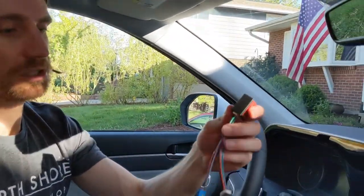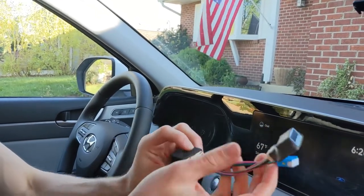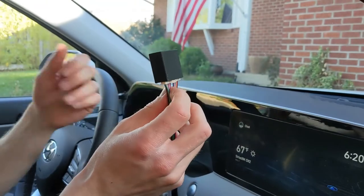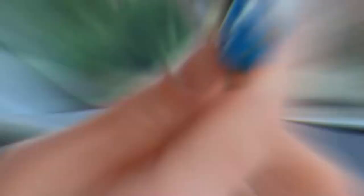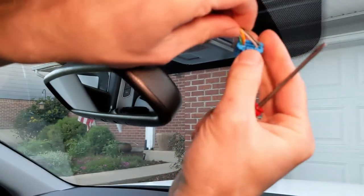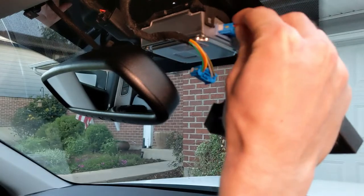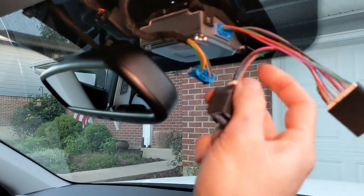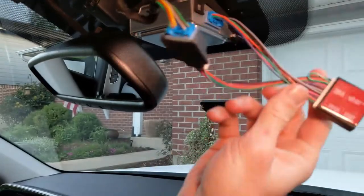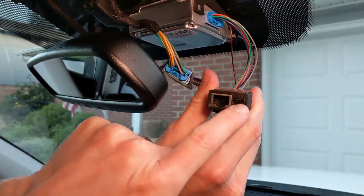Once that's removed, the next step is to take a piece of the harness that comes with the Comma 2 — this is going to be specific to your vehicle. You can see there are a couple of wires and an RJ45 port on one end, which we'll be running across the vehicle down near the driver side. Take a screwdriver and push up on the clip to undo it, then replace it with the harness clip. Make sure you clip it in all the way, then take the original clip and plug it into the harness receptacle. You'll now have on this end an RJ45 port and the USB-C cable to power the Comma 2 device.